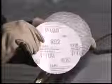Now that the repair material is cured, begin sanding with 180 DA disc. Sand the repair material level with the surrounding area. If 80 grit is used prior to this step, be careful to keep the 80 grit scratches inside the adhesive area, as these deep scratches will be difficult to remove from the bumper plastic. Finish sanding by switching to grade 320, feather edging into the surrounding area.